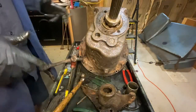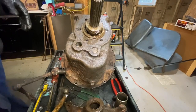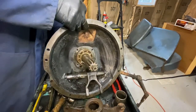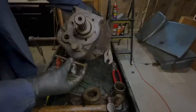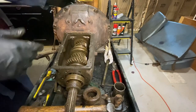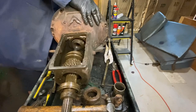I'm going to hit the reverse shaft out into the case — there should be plenty of room to access it inside once it's out. Small hammer, small taps. The reverse gear just fell down. When you go to take things out, be really careful and know where all your shims are. If the throwout is still in the front, you cannot hit this pin forward — you have to hit it backwards. I have some really nice punches just for this; I take the retainer pin and work it straight out the back. That lower gear should have fallen down far enough to get things apart, and the output shaft fell down — now I can get the input shaft out from the front.